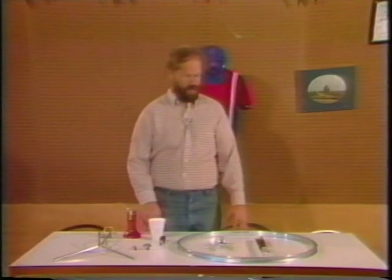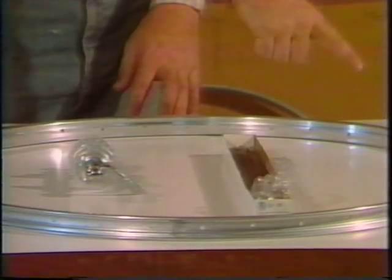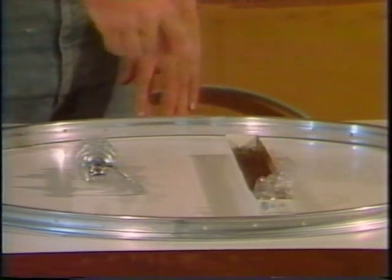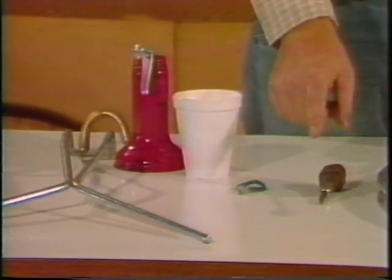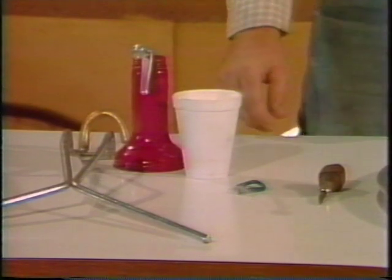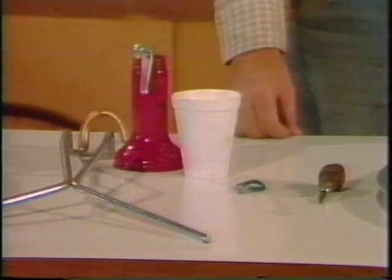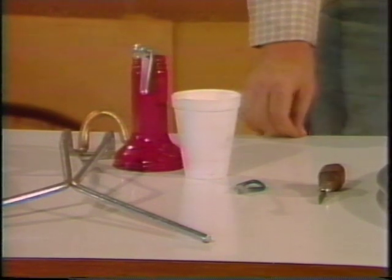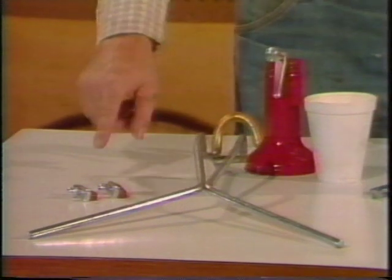Before you build your wheel, you're going to need a few things. And the first thing you're going to need is the actual components that go into the wheel. Those are the hub, rims, and a set of spokes. And you'll need a spoke wrench and a screwdriver to tighten the nipples on the spokes. You'll need oil to lubricate the threaded end of the spoke. And it's handy to have a bicycle stand to hold up the rear wheel and a new set of brake pads.